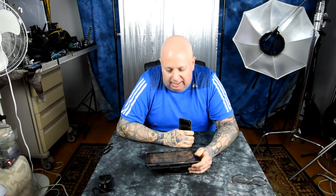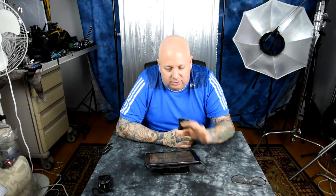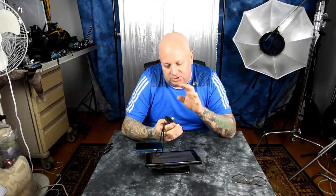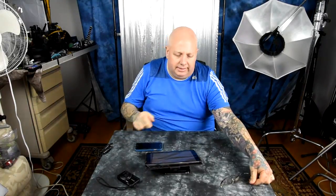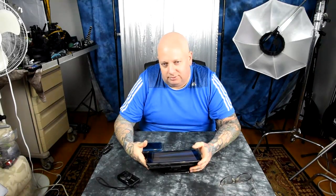Those cameras where people are scratching their heads — 'this camera's got good ISO performance,' 'this is a really high megapixel sensor' — you're right, it is not noise from the ISO or the sensor. It is noise because Sony especially, in cameras like the a7R and a7R2, has jammed a ton of electronics right behind the sensor. It's like if I had neighbors blasting guitars and drums next door while I'm trying to listen to music — even with headphones on, I can't hear well. Heat causes EMI, EMI causes heat, and it's much more apparent at higher ISOs. Professional photographers know that if you take a camera out somewhere hot, you'll get hot pixels and worse noise issues. Thanks for watching, catch you later.